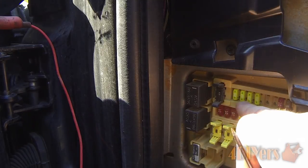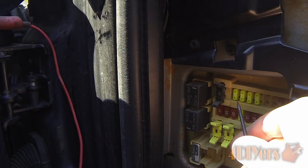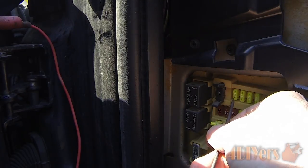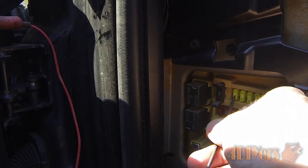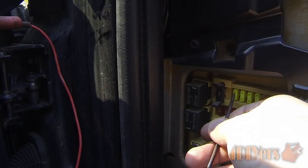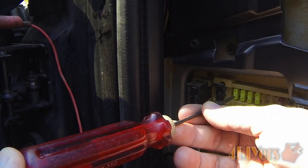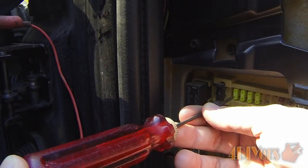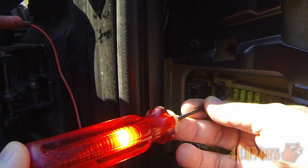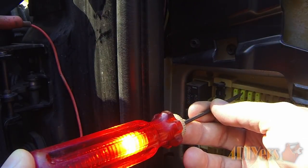When testing these fuses you'll see a little square hole on both the top and bottom side of each fuse, which leads to the metal pin inside. The reason there are holes on both sides is because the center portion is where the fuse normally burns out — one side is power in, the center is the fusible element, and the other side is power out. Testing the first fuse, you can see it lights up on one side and also on the other, and the same is true for the next one — both work correctly.